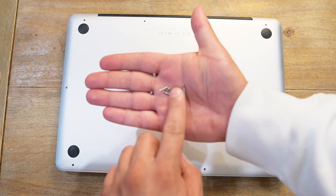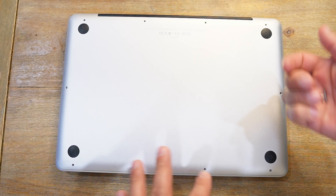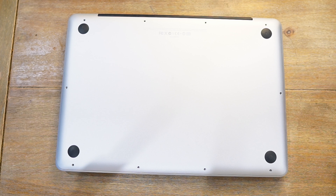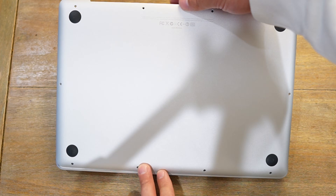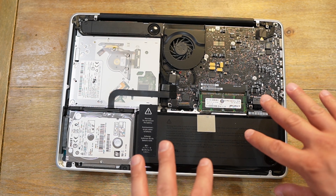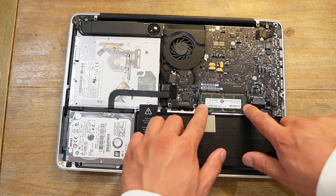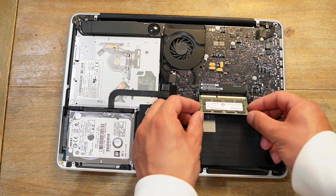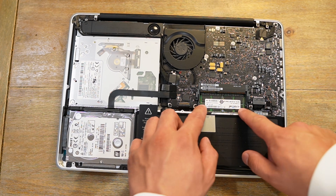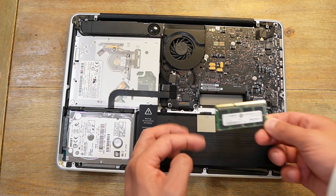You'll notice that when you unscrew all these, you'll have three long screws — those three long screws go here, here, and here. Everything else are small screws. Put them aside and make sure you don't lose them. To open the plate, just grab it from the top and remove it. The RAM is located right here. Try not to put your fingerprints on it because the oil from your skin can damage something. To remove the old RAM, pull the two clips on the sides and the RAM will pop out — remove it towards you. Do the same for the second one.